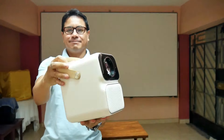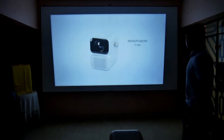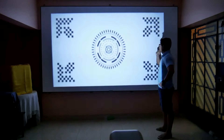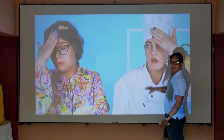This Whambo 6 Max is repaired and now it's time to test it to see how well the repair worked. We've given this good projector a second life and its owner is going to be very happy. Even the autofocus works well now. It still runs smoothly and the images look pretty good even in dim light, although it's recommended to watch with the lights off for this projector. The problem of the burnt polarizing filter is common in LCD projectors, but not in DLP projectors.